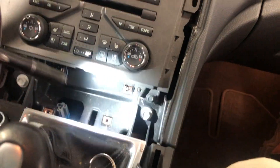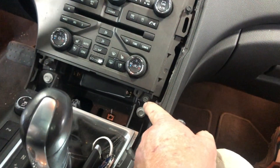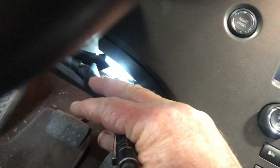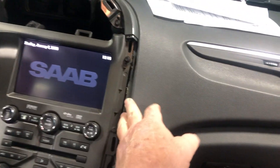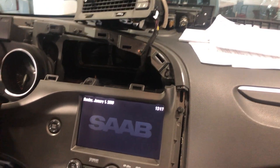You've got a handful of screws to take out. Probably the only hard part is right here — this is kind of a hidden area. You've got to get this panel to come free so you can get that stud. There's a stud that sticks up through and goes into this panel, so without that stud out, this panel won't release all the way. But once the screws are all out, everything just pops free. I started with this piece of trim here, got the cigarette lighter out, took that out of the way.